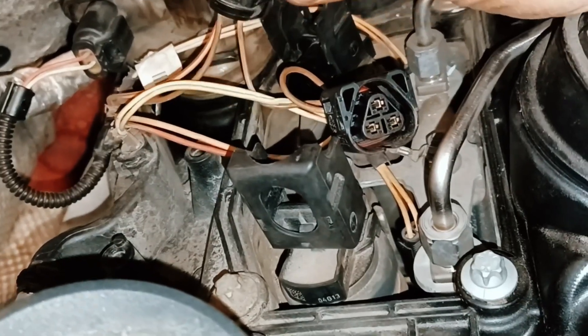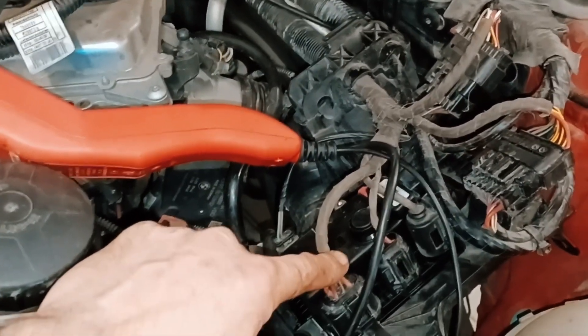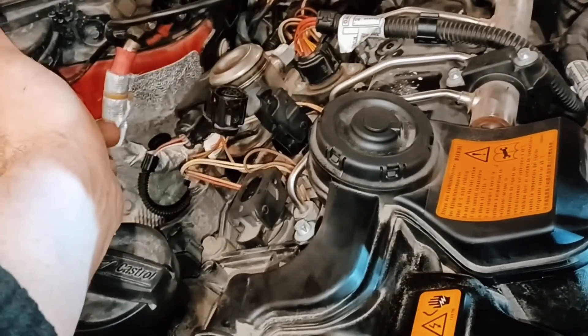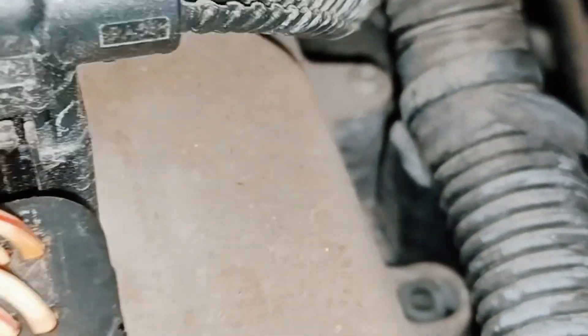The issue on this car is the signal wire to the coil has a ground on it, which corresponds with what the DME is reporting — a short on that circuit. When the DME loses that ground on the gray wire, it's doing it on purpose: disengaging the relay inside the distribution unit to stop it burning and catching fire. It's doing its job by disconnecting things so there's no load on the transistor circuit. Looking at the connector — look at that, it's been hot, it's burned — and that pin there, pin 13, is our wire that goes to coil number two.